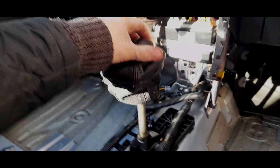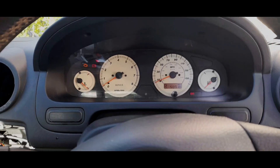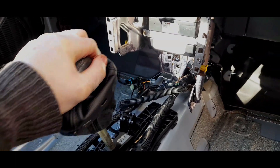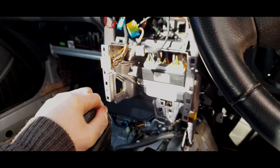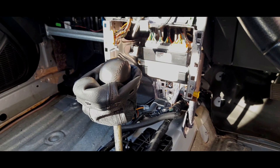There's actually one more test I can do. With the ignition on, the starter inhibitor should not start in gear — it will start in park. In reverse — nothing. In drive — it shouldn't start there either. In neutral — yeah, absolutely fine. That's just the last test today. Take care guys, see you very soon.